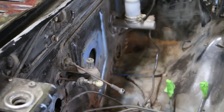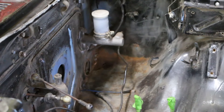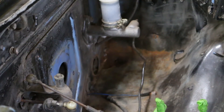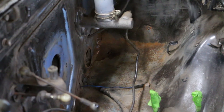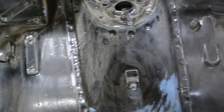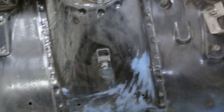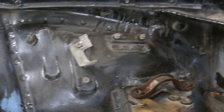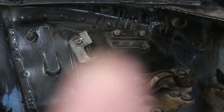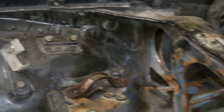Now in the engine bay on the driver side: that hole underneath the clutch master cylinder is where the boot was for the ECU plug, and the wiring ran all the way along this way. There are a couple of mounting points along there, and right up top is where your ignition coil was along with a module. Then it comes around to your lighting wiring harness and across.